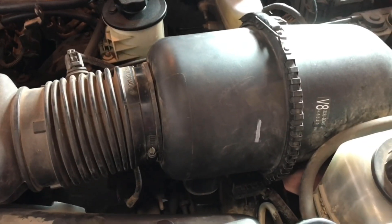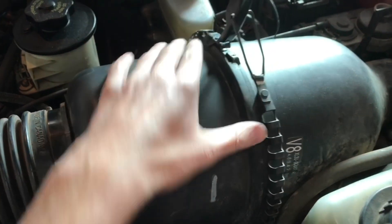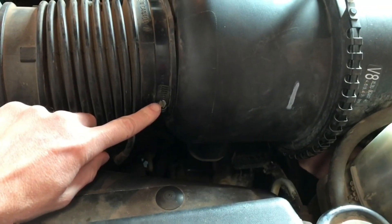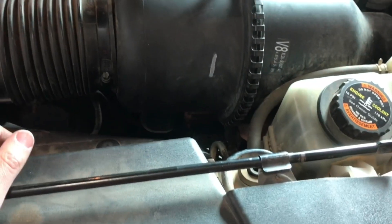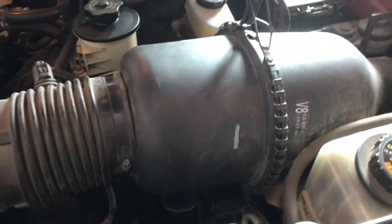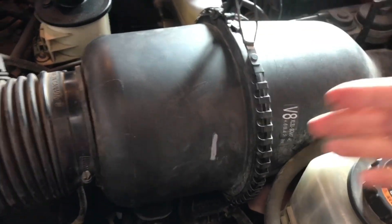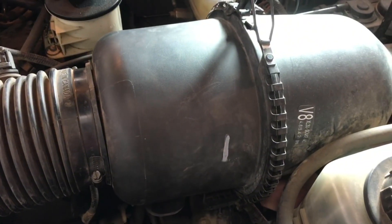Removing your air box gives you some much needed room. You just remove this clamp and that'll separate the big part from the part with the filter. And then there's an 8mm hose clamp right here — loosen that up — and then this big box you'll be able to pull it out. That'll give you some good access. And if you want, you can keep going and pull the rest of it out. Mine was really trapped in there, so I didn't mess with it because I thought I was going to break the plastic. So I just had basically that section removed and that helped.